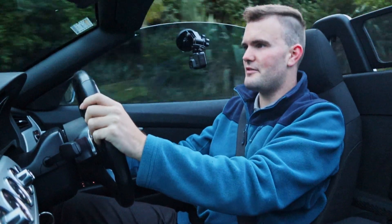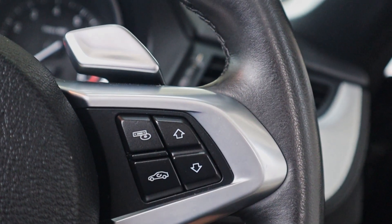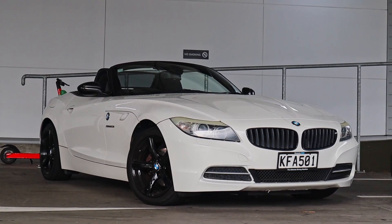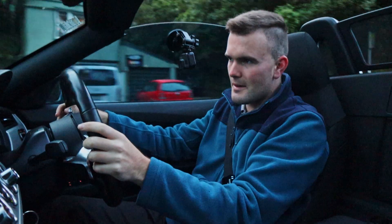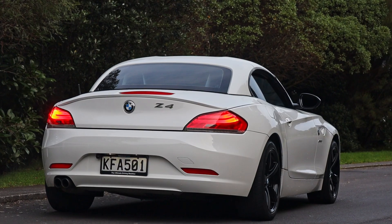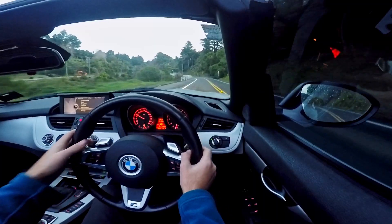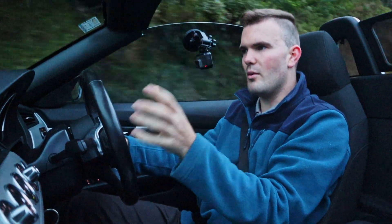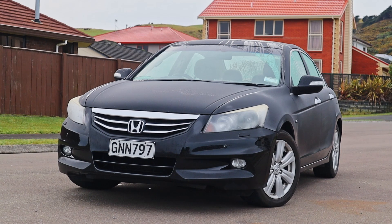The first thing you need to do if you want to learn how to rev match your automatic transmission car is find out if you even need to do it in the first place, because quite a lot of modern automatics these days — like the ZF6 in my BMW Z4 — do it for you. Essentially, the way to find that out is just to put it in manual mode, and if the car very smoothly and quickly downshifts and quite obviously drops a gear, then you'll know you don't need to do it yourself. Most automatic transmissions, if I'm being honest, don't take too well to rev matching. It's not that it's going to damage them, it's just that most automatics keep a constant mesh, so there isn't an obvious gap between gears where you have an open window to blip the throttle — and if you try, it'll kind of lurch around. This V6 Accord, on the other hand...